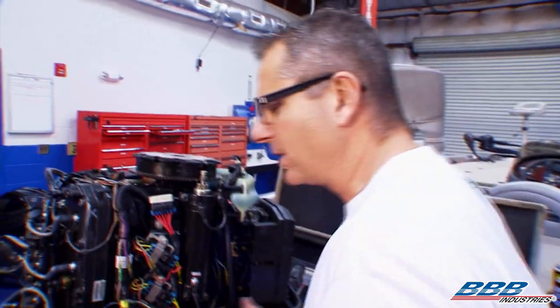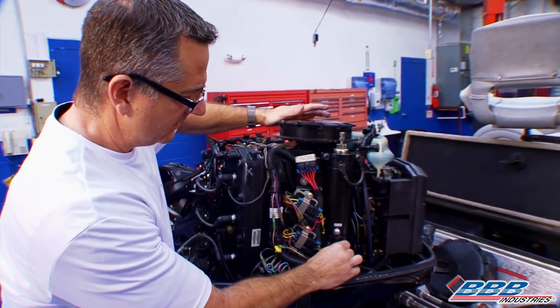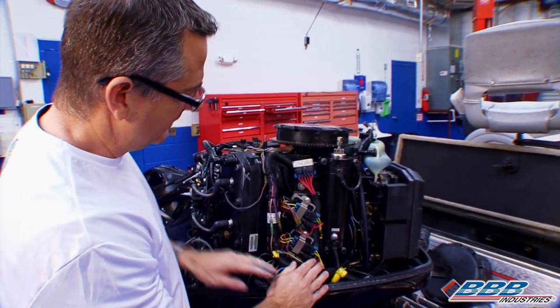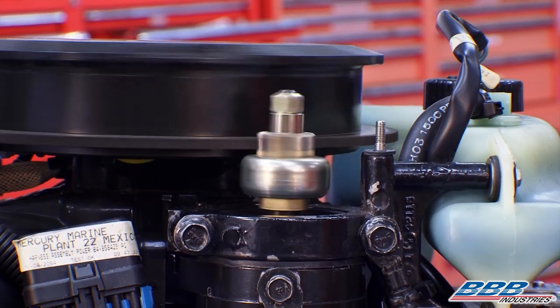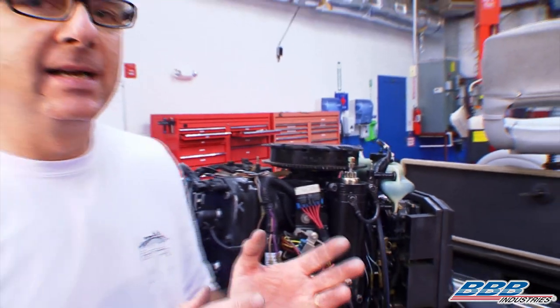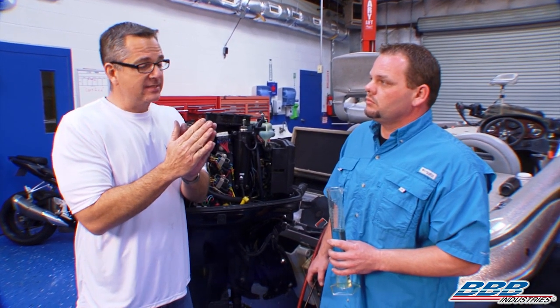All right, we've got it all hooked up. We're looking for proper pinion contact — make sure the pinion is going to contact the flywheel. Check that all connections are secure and everything is out of the way. Everything looks good and bolted up. Let's give it a spin. We're looking for pinion contact. A few tips whether you're working on a car, boat motor, UTV, or ATV: if the starter motor makes a high-pitched whine while cranking, it's too far away from the flywheel. If it makes that whine after you release the key, it's too close and binding, then popping out. This one's in good shape, so we'll button it up.